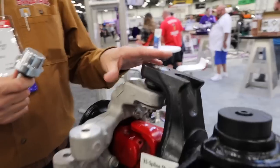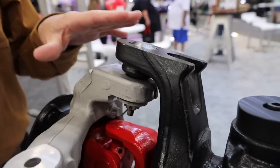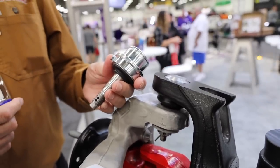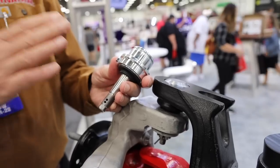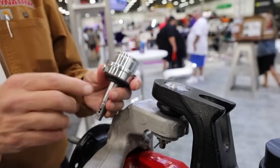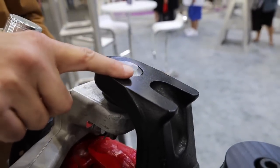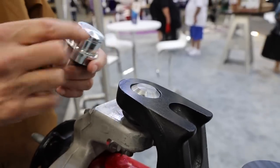And that person was wondering why we went to so much effort to do this. So the reason we did it was that the original ball joints tend to wear out prematurely, or at least sooner than the customer would like. So we wanted to have a more durable ball joint. We also wanted to make it so that he could rebuild it over and over again without wearing out the press fit between this housing and this yoke and the ball joint itself.